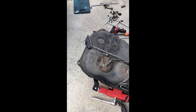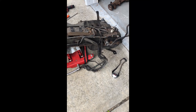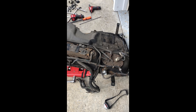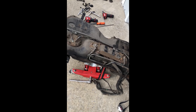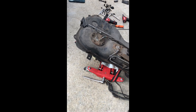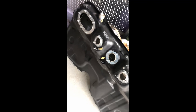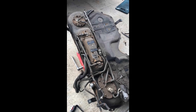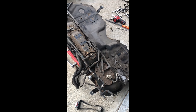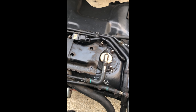The whole tank is out. When lowering it after removing the bolts it kept tilting down toward the passenger side — it's not jamming, it's just so much heavier on that side. I was able to support it solo and slide it sideways out with the jack. Now starting the rebuild: Subaru sold me a complete gas tank, but it turns out it's a bare tank — no pump, no jet pump included. All the sensors and hoses have to come from the old one to the new one, and some of those clamps don't look good.